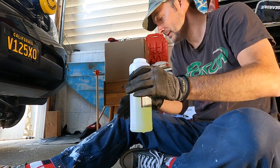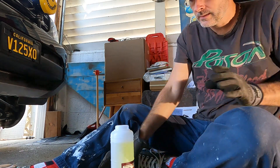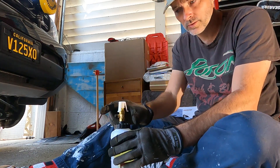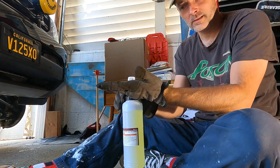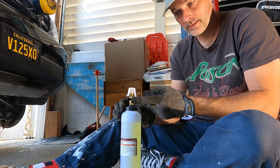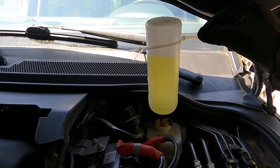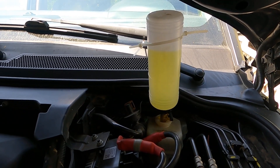Always leave a little bit of an air gap. Get the lid back on the new stuff. Making sure we don't cross thread. Double check that our valve is closed — across the way that the flow is generally means closed, 95% of the time. Some valves are not like that but they will be clearly marked. This one, when the levers are crossed, means it's closed. This bottle is not perfectly vertical but it stops at about 90% fall which is great — I can't afford for this to fall off, ever. So I've just got some cable ties here to stop it if it wants to fall backwards as it gets emptier.